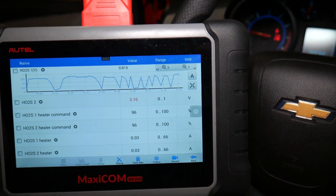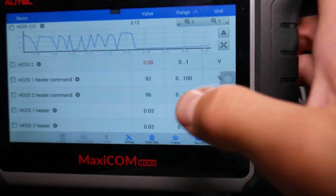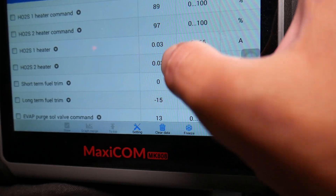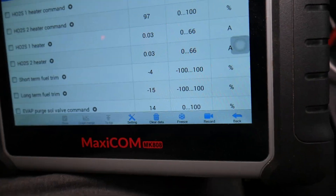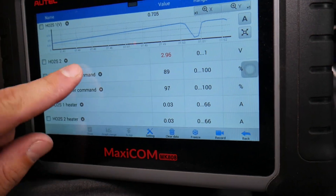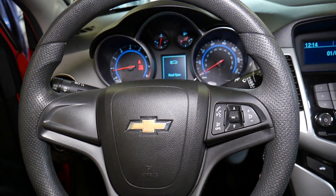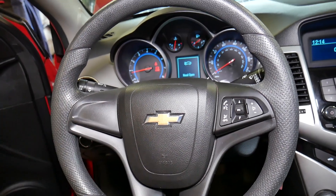You can see that's a good graph of a good sensor. If you scroll down, you can even check your heaters — that's for when the engine is cold. The heaters sometimes burn out, so you can check if they're activated or not. That's a great way to do that as well. This is the easiest way to test oxygen sensors. Hopefully the video will be helpful — thank you guys for watching, please subscribe to the channel for more videos, and see you next time.